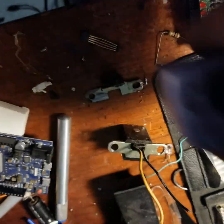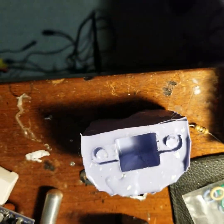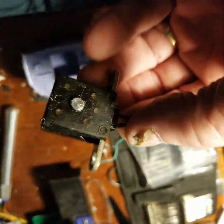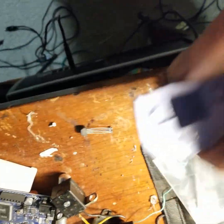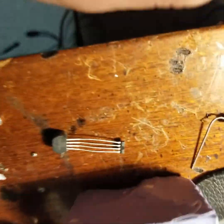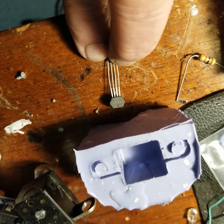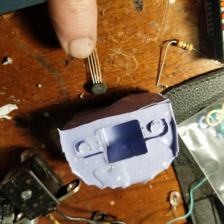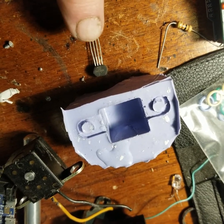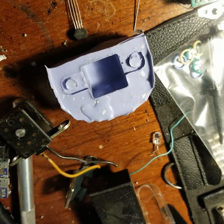This is the mold that I made for my position sensor. I made it off of one of these — a Kawasaki crank position sensor. There's my little transistor. Actually, there are two Hall effect sensors in each device, and it uses three wires: ground, signal, and plus five volts. Plus five only — not 12, because it'll fry it.